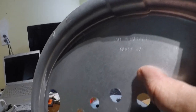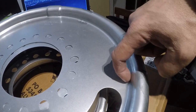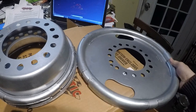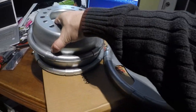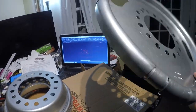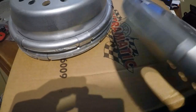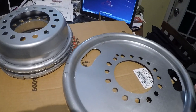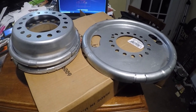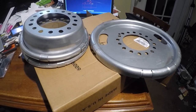They're labeled for the Chevy. You can see it's been spot welded, clipped, and sealed in place, so these should hold up really well. These feel heavier than the fronts, which makes sense because you're doing dual wheels and need more weight. The rings are also a larger diameter because you're balancing two rear tires instead of one. I'm going to try these out this weekend and take it for a test drive on the highway, getting up to 65 miles an hour.